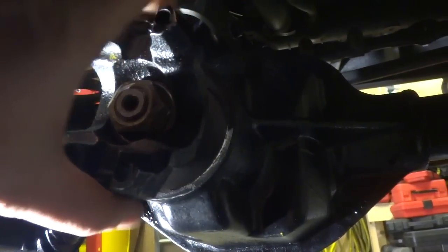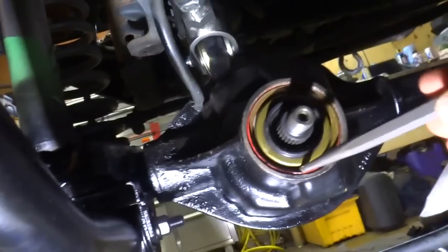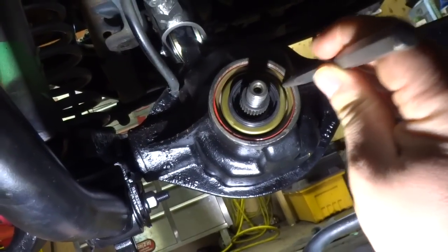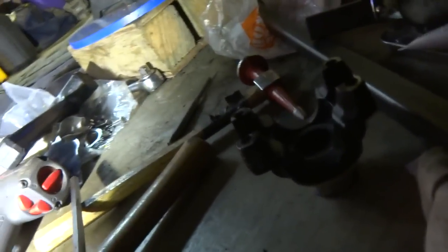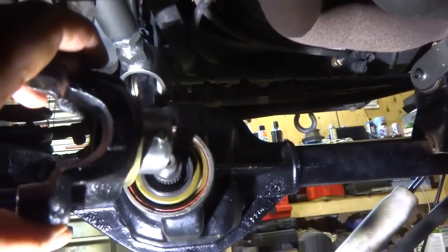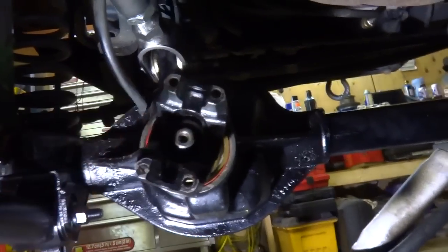I didn't want to damage the seal, so now I'm going to take the nut off, pull the yoke out, and then install the seal. Getting the seal in does kind of suck — all I did is I used a punch and went inside of the edge where it's still pretty solid, and I just tapped it lightly to get it in, going from side to side. I didn't get that on camera, sorry. Now I'm going to put a whole bunch of lube on the shaft and then we're going to stick that baby in.